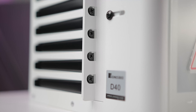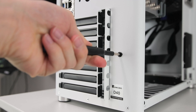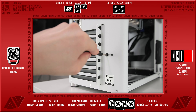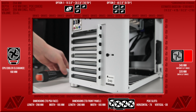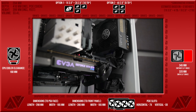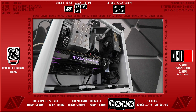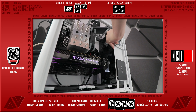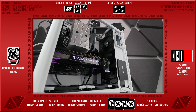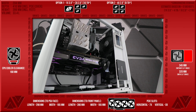For the graphics card installation, they've opted for the sensible standard screw instead of fiddly thumb screws wedged into awkward corners. The installation was simple, but the dimensions available need a little clarification. The length on the left is the GPU length plus the horizontal distance to the face of my standard PSU — relevant mainly if you have a really long 200mm PSU. The length on the right is the GPU length plus the distance to the front panel. Focus on 298mm as your soft maximum and definitely stop at a hard maximum of 310mm to avoid trouble with PSU cables.